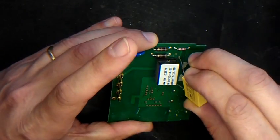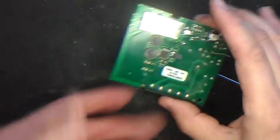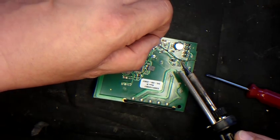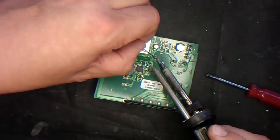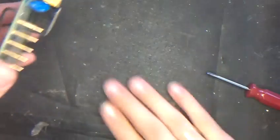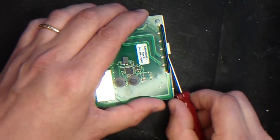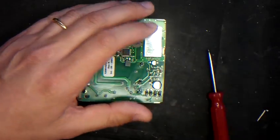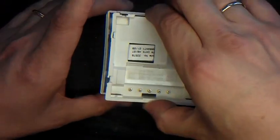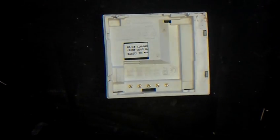New cap goes in. The legs are round, and then a re-solder — heat the joint, add the solder, heat the joint, add the solder. Trim off the legs. The board can just click in. Push this back in there. Make sure your buttons are safe — they can fall off. All done. In four minutes. Thank you.